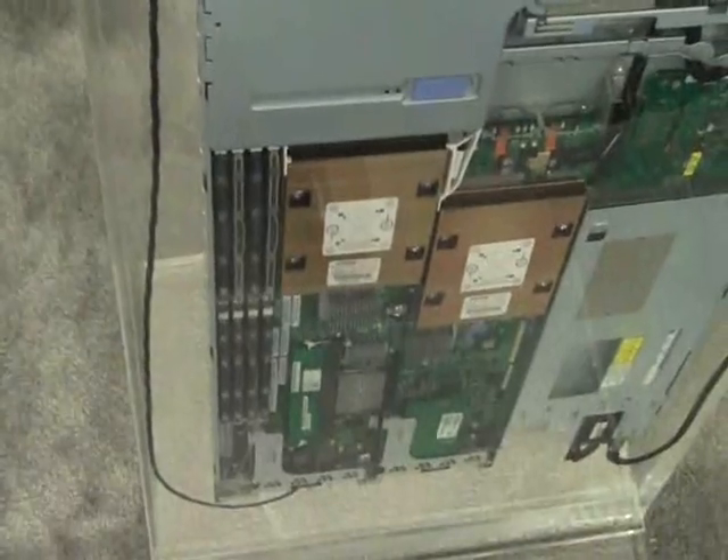We've done a few basic things. One is we remove the CD-ROMs, which most data centers aren't running these days. Second is we remove the fans, which saves you about 8 to 25% of the power in your system itself. The third thing is that there is a grease underneath the heat sink which we change out with something that's more compatible for our coolant. But other than that, it's a bone stock system.